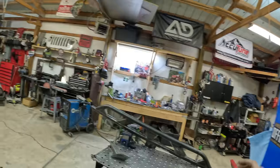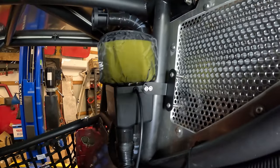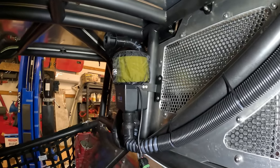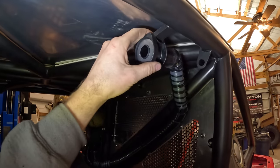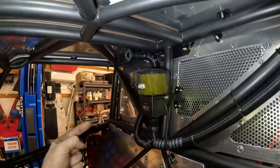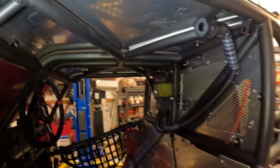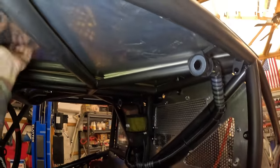Air pumper attachments are on — we mounted the air pumper. It came with brackets made for a flat panel and it worked perfectly. We passed the bolts through into the perforated steel with a little spacer in between — it's actually really solid. We ran the lines, zip-tied them, and welded our weld-on block for our magnetic quick release. Our helmets both have the air attachment on the left side, so they're both offset for an easy-to-reach area. Under the roof we put some trim to cut down on rattling — a lot of times you get a ton of rattles when you have aluminum bolted onto steel.